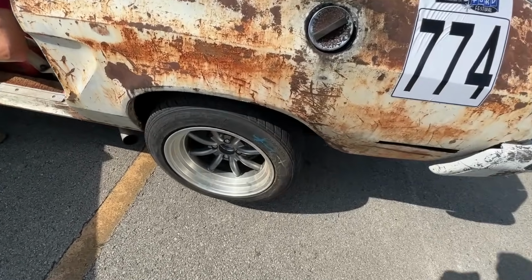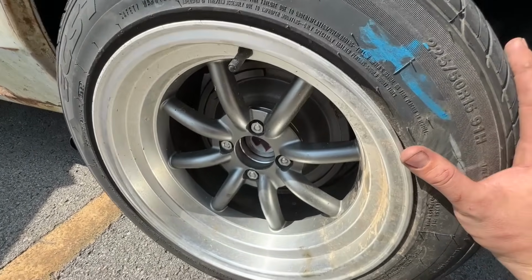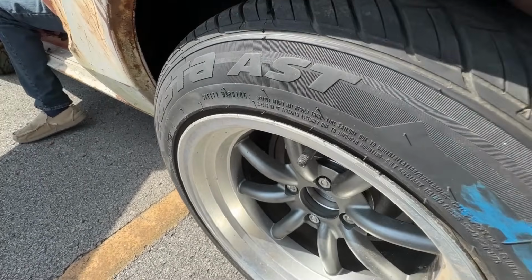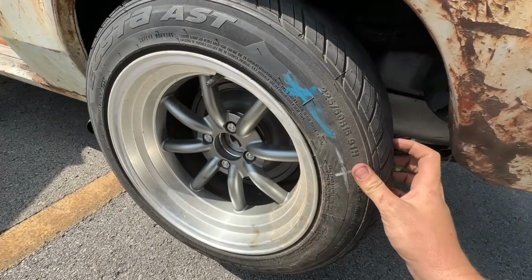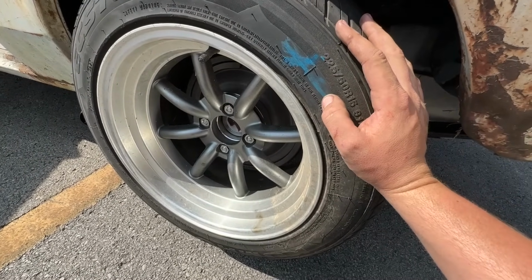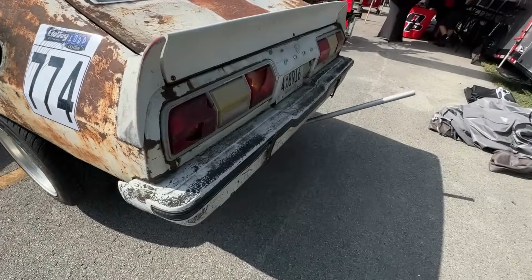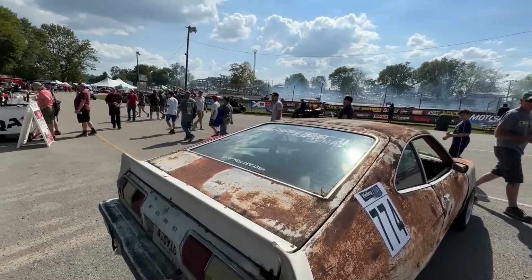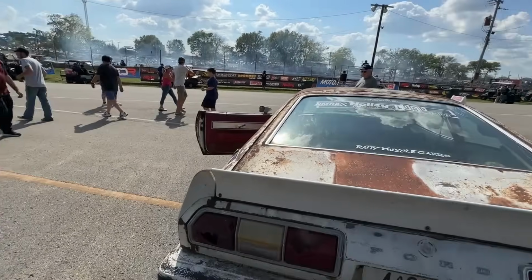So we got them adjusted, and I don't think that the shoes were even touching. You holding the pedal? So now Briar can hold them still. They're much tighter. They're probably tighter than they need to be, but I need to be able to stop. We were not using the rear brakes at all out there, but now it should feel much better. So that'll help a ton on our times, because I was having to fly, but I'm slowing down way too early. So I'll be able to get a little bit more wild with it.